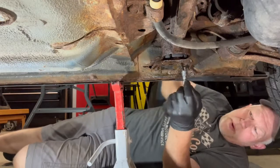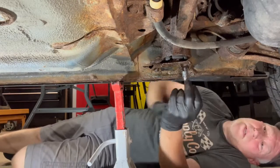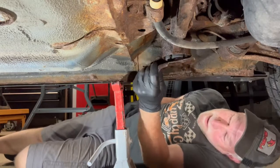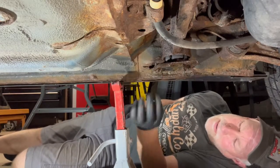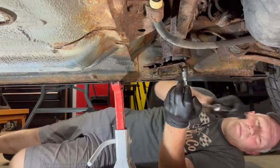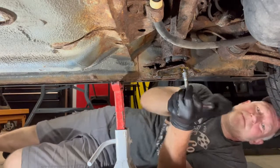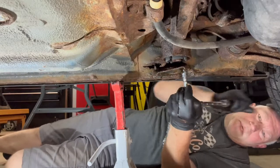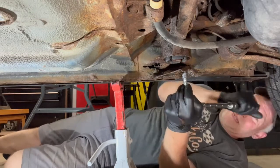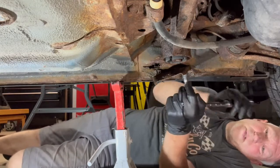Looks like I'm going to have to do some work on the passenger side now too. Sometimes things don't go the way you want them to. It's good that I did it because I want this thing to be safe on the freeway. The bolt on the back side — that whole thing is rotted out — so I'm going to fix that and put a tapping plate underneath. I'm going to hope I can get the rest of this out without breaking the bolt; it's a little snugger than I think it should be. A little more PB Blaster. I've been dreading this project for a while for things like this, but I decided to just dive in and fix it all so it's safe to drive on the freeway.